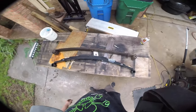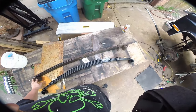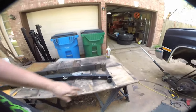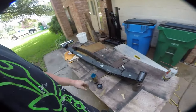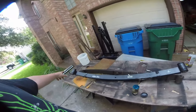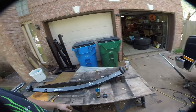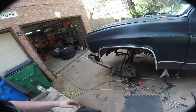Here's a good comparison. Even though this gives four inches of lift, you can see this old one is basically just flat and wasted. As I mentioned earlier, the plus sign goes to the back — I'm going to double check the instructions. Other than that, we just slip it back into its factory hole and bolt it up. One other thing to keep in mind — I used a little bit of heavy grease. You want to grease up these bushings. The larger set goes in the front; the plus sign and the smaller set go in the rear.